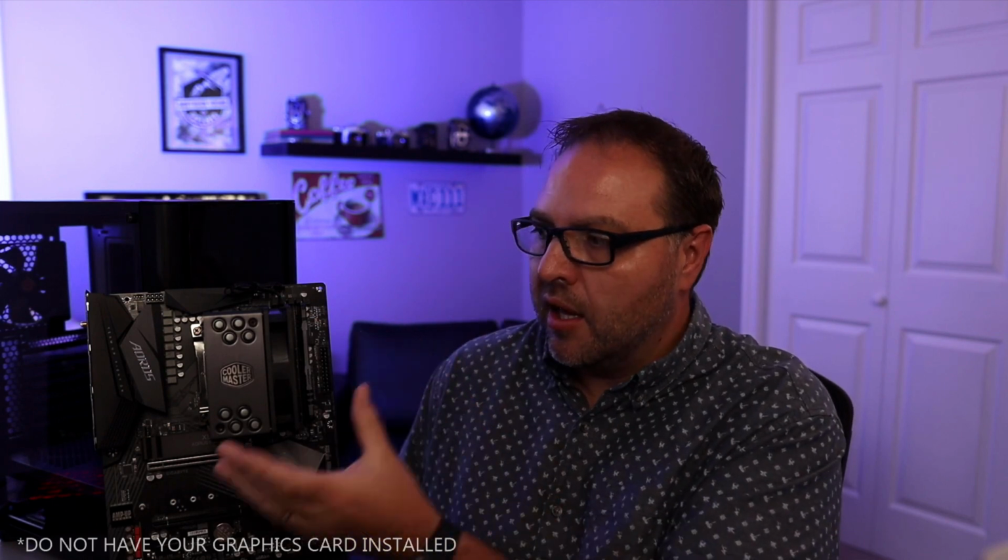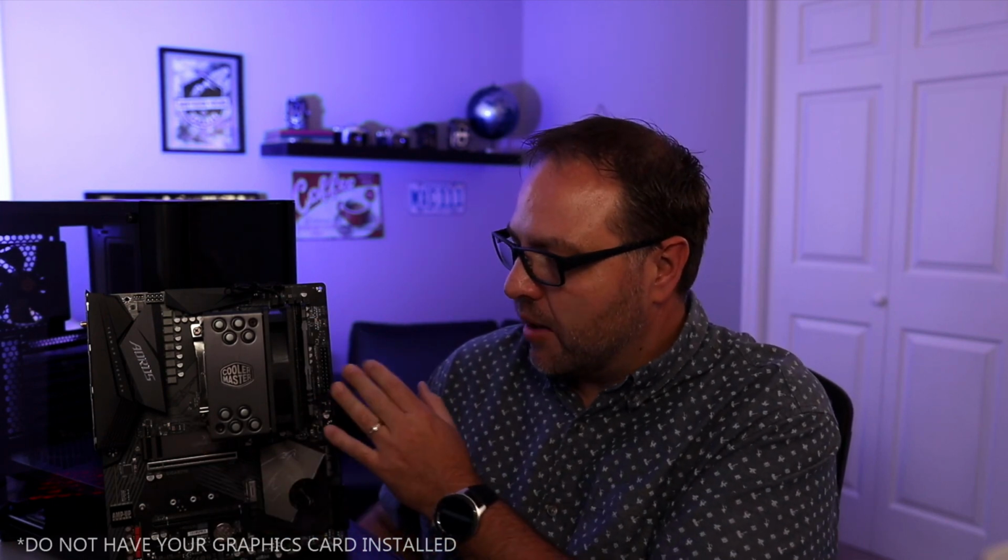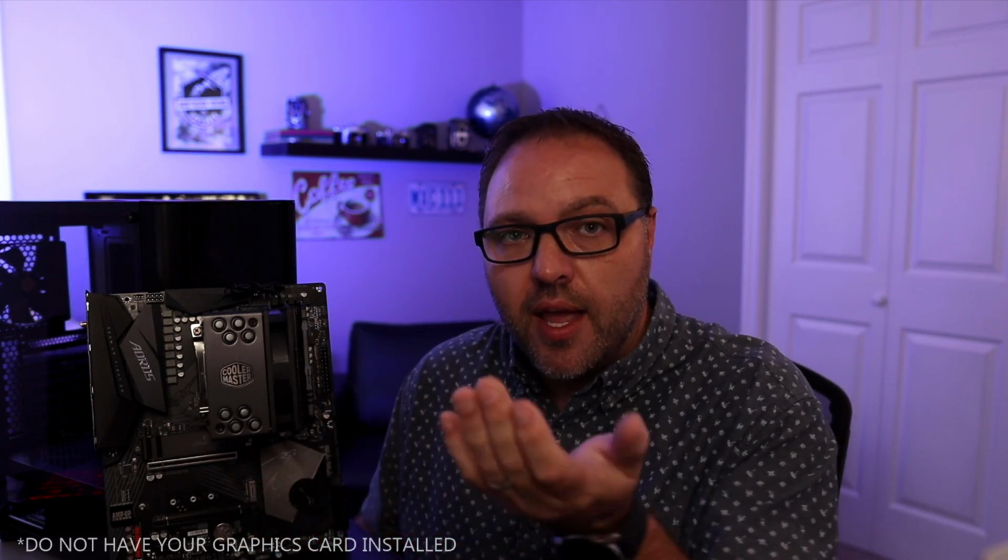So a couple of quick things I do want to mention. All of these PC components I did pick up from the store. I will put links below in the description if you do want to grab them for yourself or find more information. The other thing is make sure that your motherboard is fully set up before you install it in the case. So I've got my CPU installed, I've got my cooler installed, I've got my RAM, I have an M.2 NVMe drive installed. So make sure it is fully assembled before you install it in your case. Let's dive into how to do that.